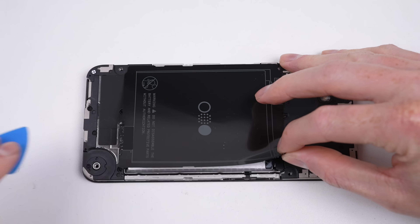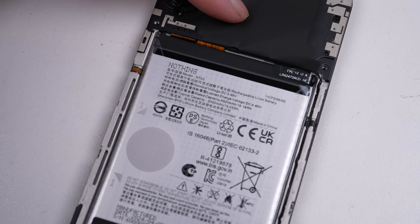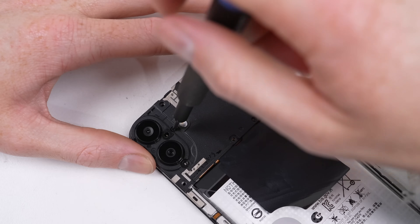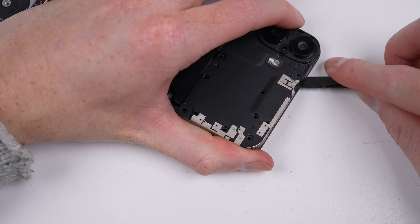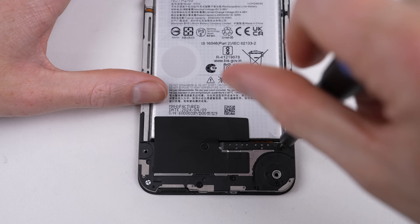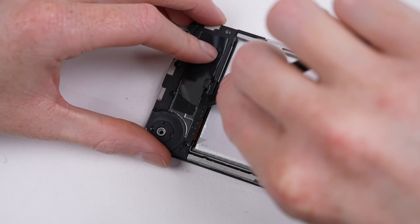Let's see what's under this plastic cover. The two tabs at the top and bottom of this cover are void-if-removed stickers, and leave a series of dots when pried up. Underneath is the as-advertised 5000mAh battery, but how easy is it to remove? It appears Nothing avoided the opportunity to make this battery user-replaceable, which is incredibly strange considering they went to the effort to incorporate an interchangeable back panel. I'll need to remove the upper antenna to reveal the motherboard and its connections. It was held in with screws and clips, the clips being the strongest I've ever come across. Void-if-removed stickers are also present on the antenna we just removed and the speaker.